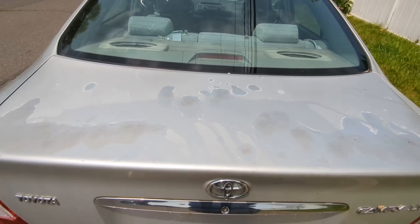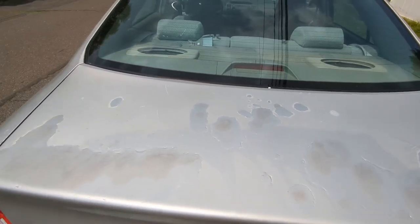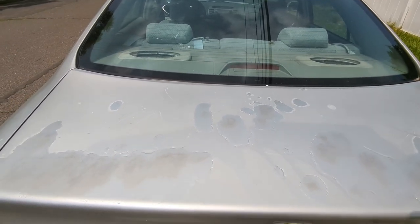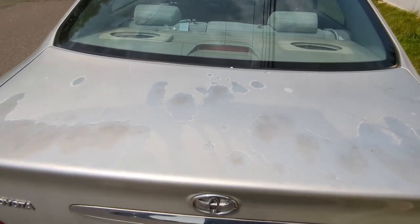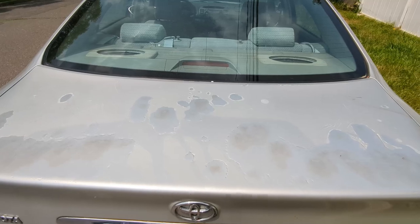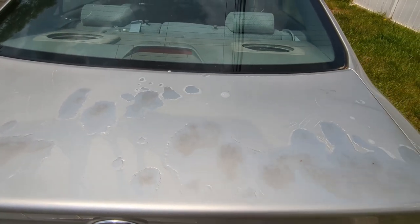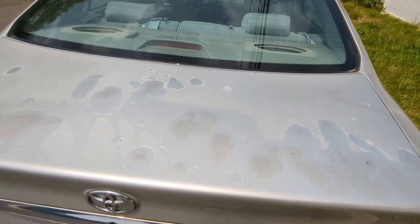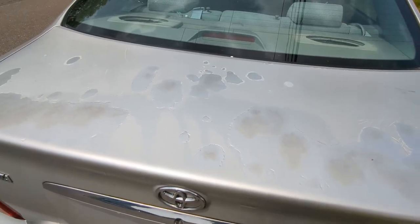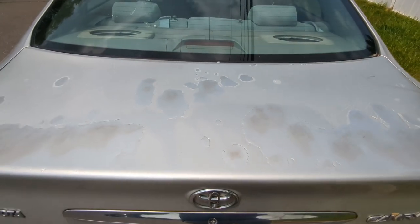This is going to go one of two ways. If after you pour the water on the car it basically looks like it's brand new again and you can't see any imperfections, then that usually means it's just a clear coat that's messed up — and generally that's an easier and cheaper fix. If it's looking like this and you can still see the imperfections, then that means it's not just the clear coat but also the base paint that's messed up as well. That's the situation we have here, so that's what we're going to be working with today.